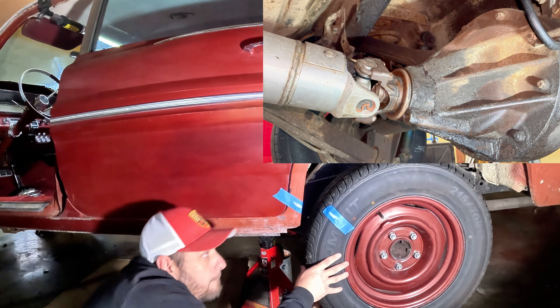It's best to think of these in quarter turns. If you rotate your tire one full time around and you get about two and three quarters of a turn, you're going to have something like a 2.73 rear gear ratio. If you get three and three quarters, you're going to have something like a 3.73 ratio. Don't get caught up in that last hundredth decimal place — think of it in quarters, it's going to make your life easier.